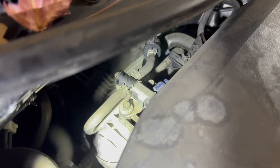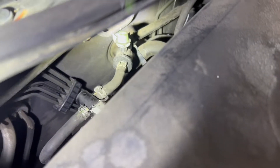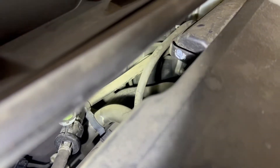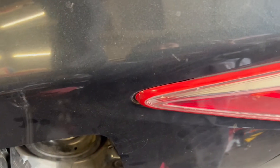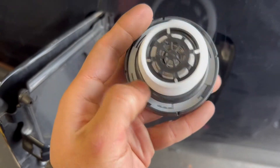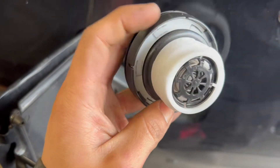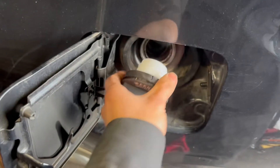I'm just showing you how the purge valve sits — those are the two holes here, the check valve, and the other end is where I put the smoke leak in. Here's my old gas cap. I bought a new gas cap right here — you can see the gasket is good. If you want the part number, that's the part number.